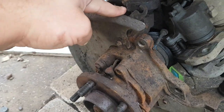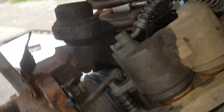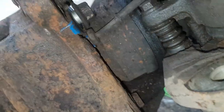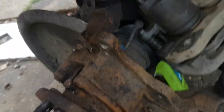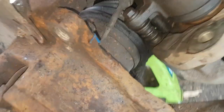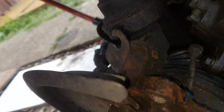Right, this is the next day. I've put my original dust shields on and given it a bit of a clean up. I noticed that the little rubber grommet for the sensor wasn't in its housing properly — I didn't want anything to burn through it — so I've taken that off, re-seated it properly, and put the bolt back. If a job's worth doing, it's worth doing properly. Because if I go through the wire, that's going to throw problems on the dash, which I don't really want. Today this should all be done and it should be on the ground.